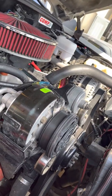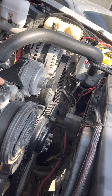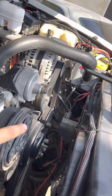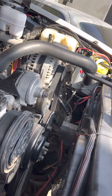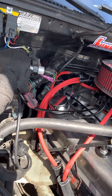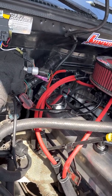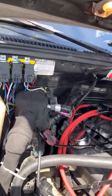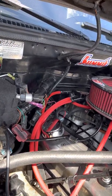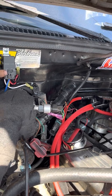That's basically how I set it up, and I'll show you guys how I did it. So here it is. I'll start with reversing the polarity on my compressor. For those of you who have done this — you know that this green one is positive. So when your compressor turns on, this is the clutch — it turns on your clutch and it starts spinning. This is a positive current. A lot of people just connect this to one relay, but then you can only use one fan specifically just for AC, and the other fan is specifically just for temperature. But what I want to do is use both of them for two separate things. You have to use three relays. This relay right here is my polarity change. You run that positive trigger wire from the AC and run it to the white wire, which is going to be pin number 86.